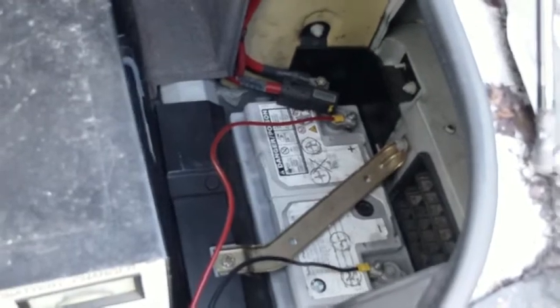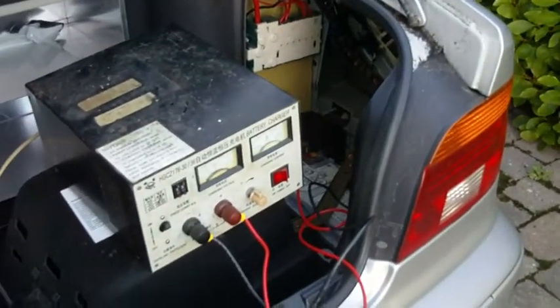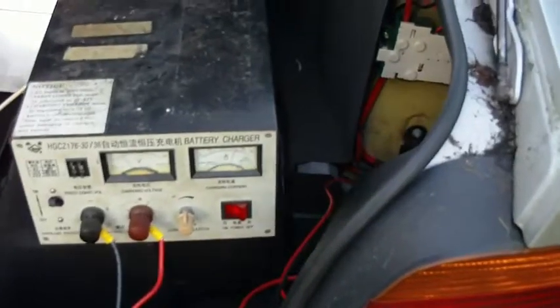The next thing that would be a good plan, especially if you've got a crappy starting battery like I have: I was doing some tests and all of a sudden I started getting all kinds of strange readings and the dash died — it turned out the battery had fallen to about 6 volts. So I've got my big 30-amp power supply on there now, pumping amps in and keeping system voltage where it needs to be.